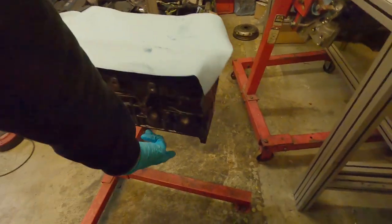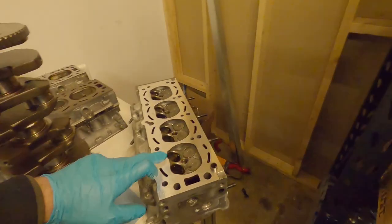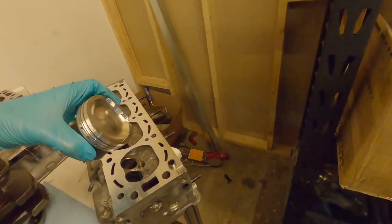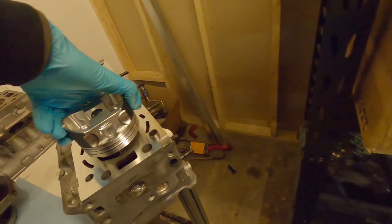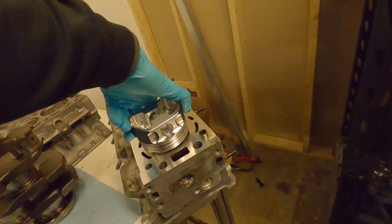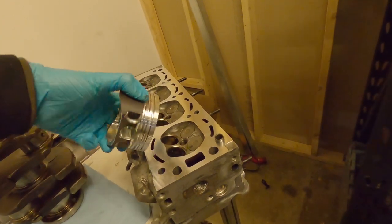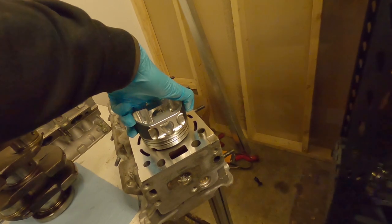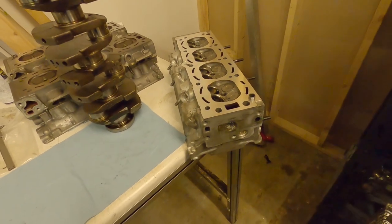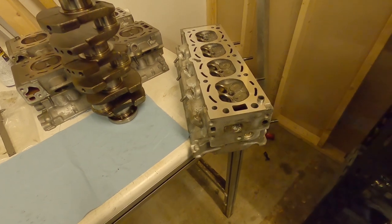Because the deck surface and the cylinder head have both been skimmed, we need to be careful that the pistons aren't getting too close to the head. This outer part of the piston needs about a millimetre's clearance. If we've removed material, we'll be getting even closer, and with thermal expansion everything gets bigger when hot - just because it turns over cold doesn't mean it's got enough clearance when warm. If the protrusion is too much, we need to get a thicker head gasket.